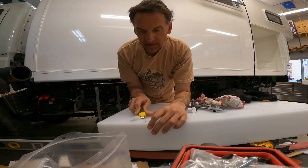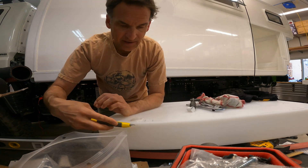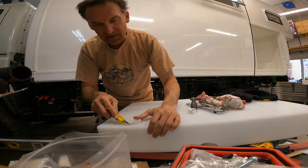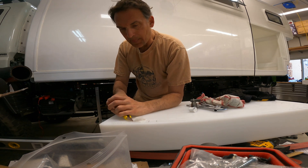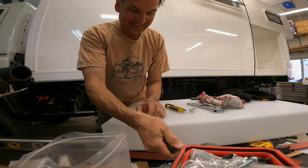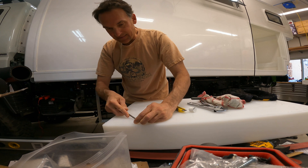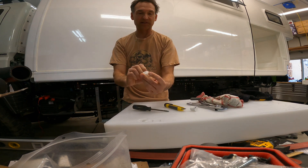Here's what I've got to do — basically take a thin razor blade, carefully without cutting myself or digging into the tank, and try to cut around it. It's a tough one because it's really well welded on one side — it got wobbly so it didn't weld the other side. I've got enough cut there. Now I can pry that off — look at that, came off really nice and cleanly.